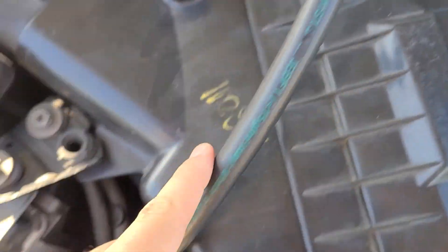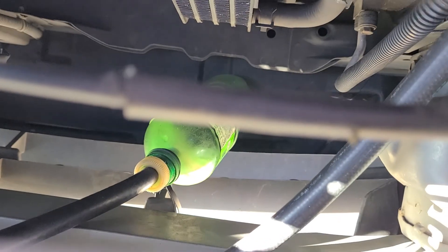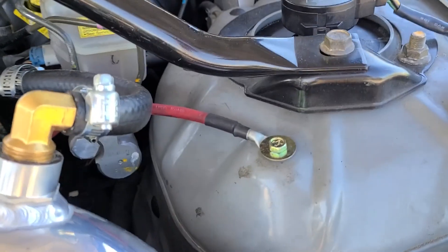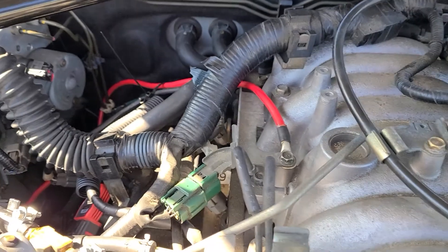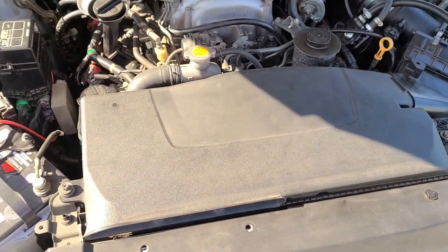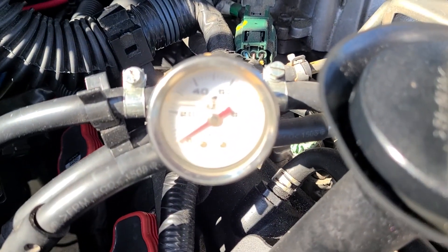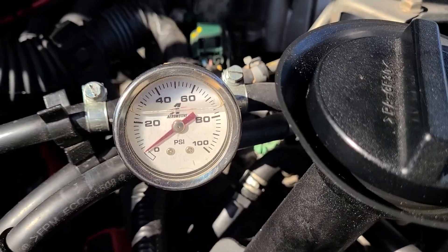This catch can goes all the way into the front into this 1997 Ford Cobra smog pump, and then finally into our racing Mountain Dew bottle. I've ported the throttle body — just very minor, just kind of smoothing out all the edges. I went ahead and made my own grounding kit. You can roast me for using red wire — I know it's not the prettiest thing, but I just added a 6-gauge wire to each side of the block and also one to the throttle body. We're also using the Audi R8 coil pack — my friend makes a plug-and-play kit for them. We've got the Aeromotive fuel pressure gauge, which will be really crucial when we go forced induction or start spraying nitrous.